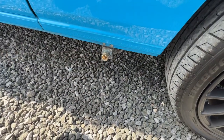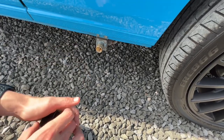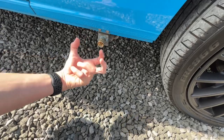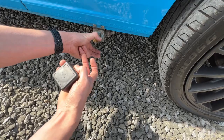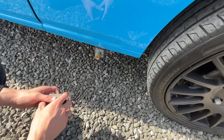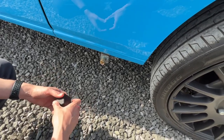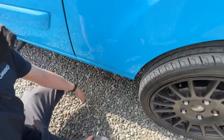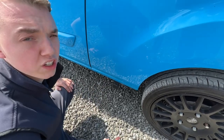Here you have your gas filling point — this is your gas connection when filling from an LPG station. Push the fitting on; it's a big round nozzle. Twist it on and flick the lever back onto the gun so it's pressurised, then press and hold on the pump dial until it simply won't take any more — that means your gas system is full. It's a 25-litre gas tank and there is an indication of how much gas is on board inside the vehicle.